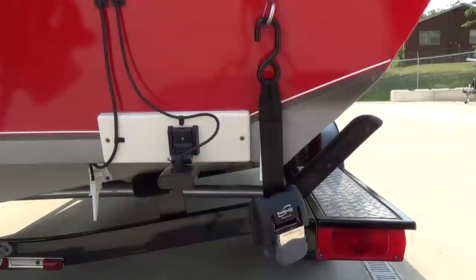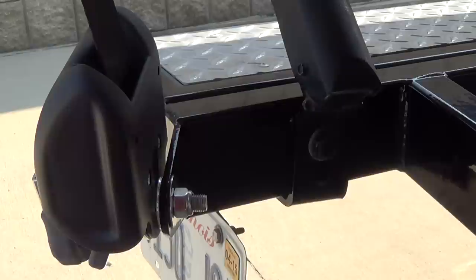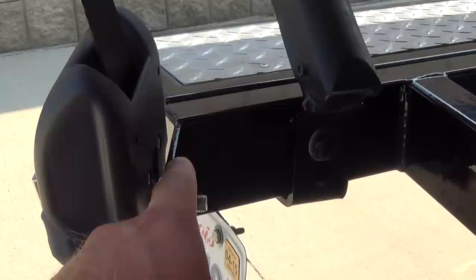A couple of clicks and they're good and tight — you're good to go. Not only do the Boat Buckles look cool and they're easy to use, but they're simple to install as well. For install, you're going to need a 7/16th size hole or bigger. The reason I say bigger is because a lot of us are going to use the hole that's already in our trailer tabs, and that hole is bigger than 7/16th but still works for the install.